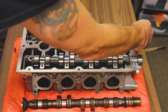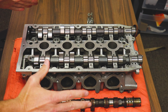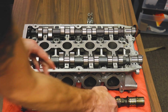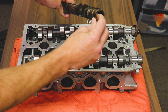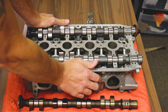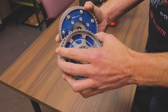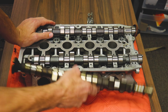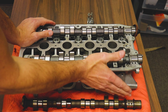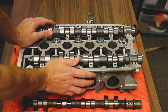It's the same thing on both camshafts. The stock camshafts do have VVT. These camshafts are mechanical with no VVT or variable valve timing. So we'll be locking everything out with these and the other cam gears, which I'm happy about. Currently, it's really a pain tuning the Fuel Tech for this stuff — it's always been problematic. When it works fine it works great, but when it doesn't, it's just a pain in the ass to get working again.